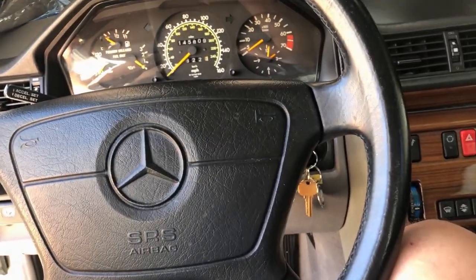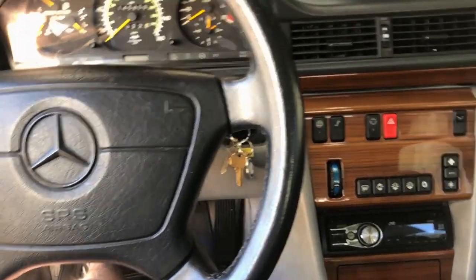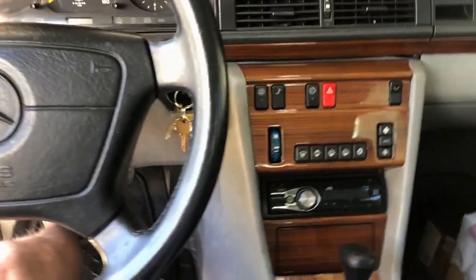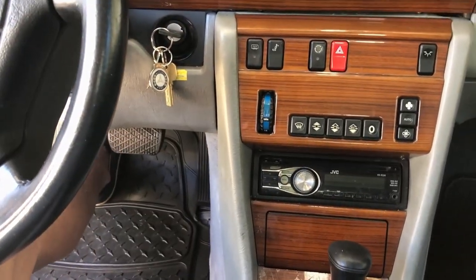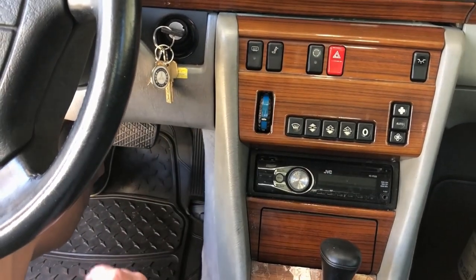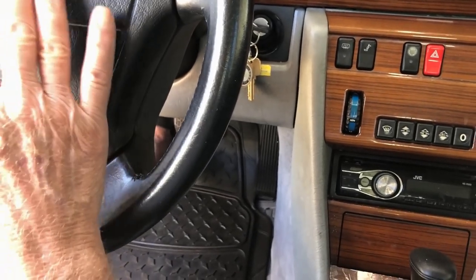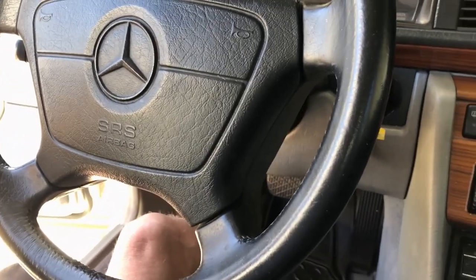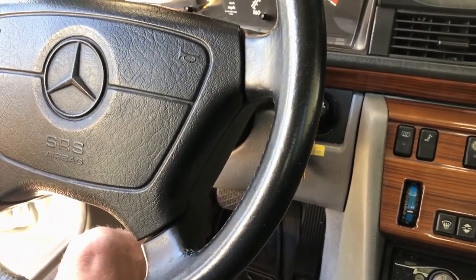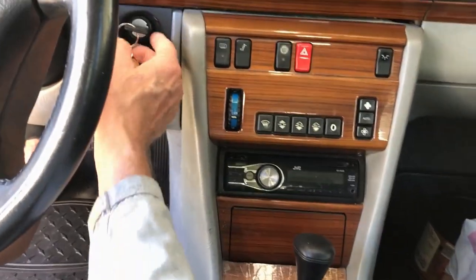and the headlight switch. The first thing I do is disconnect the battery. You're supposed to let it sit for about 15 minutes. I let it sit for 15, 20 minutes. I turn the key on just in case any of these modules have power in them, to let them drain, especially for this. You want this to be deactivated because it can go boom in your face. Never does, but you never know. Okay, so I'll just leave that like that.